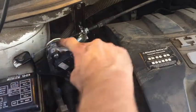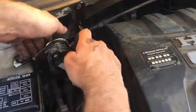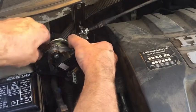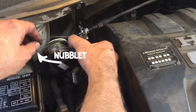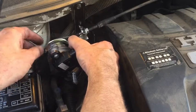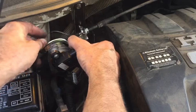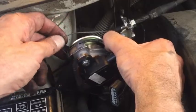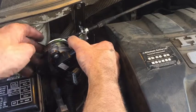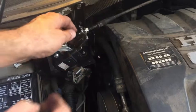I'm going to pull the accelerator spring there. The cam — just rock it forward so that you can see where this little nublet — I don't know what to call it — is going to slide down. Pop the cable so you can get it looped kind of like this, then slide the round part through there. The cable goes through that little slot — remember that — and then just let it go at the top and let off of that. We're locked back in.